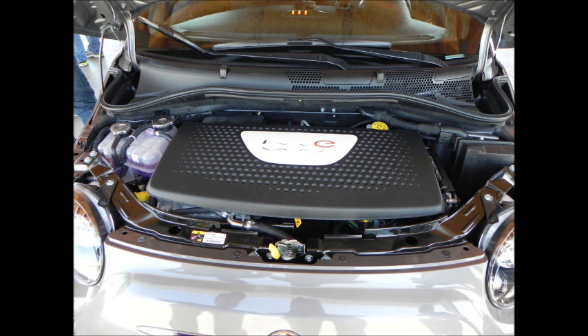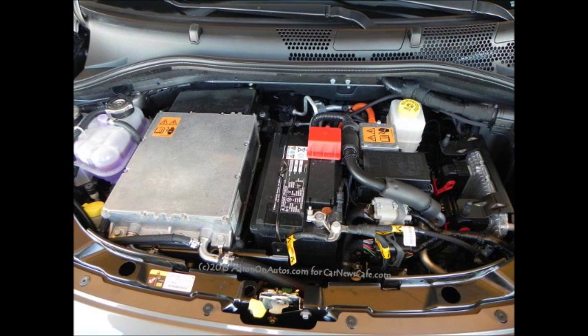Getting under the hood, Brett and I spent a lot of time discussing the powertrain. Looking into the engine compartment with the plastic cover removed, going from left to right: there's a large controller box with electronics tied into the thermal management system; underneath that silver box is the motor itself, coupled to a simple gearbox for front-wheel drive and reverse gearing. At the center is a standard 12-volt automotive lead-acid battery that runs the vehicle's accessories.